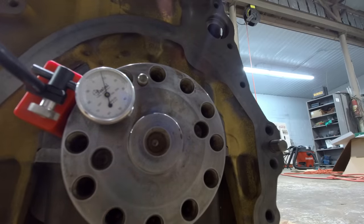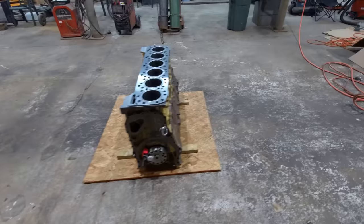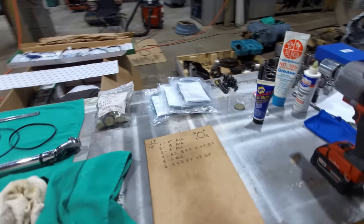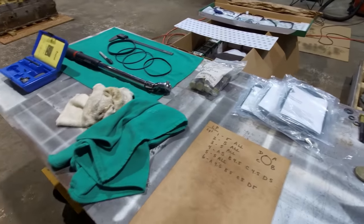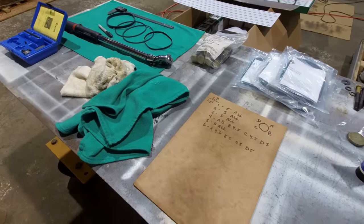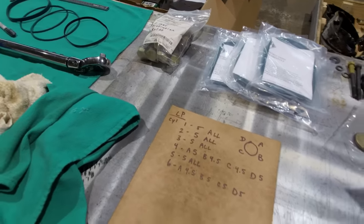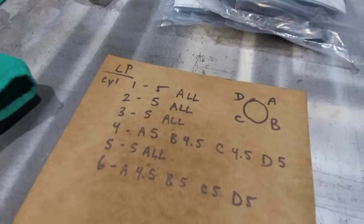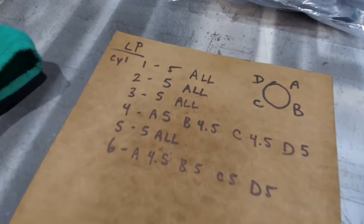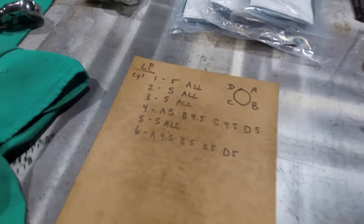Right back to 8 thousandths — that's well within spec. When I talk about something being in spec, I'm always talking about new spec, not max permissible. Like with crankshaft end play, I've got 8 thousandths on this engine. To be within new spec, I can have as much as 22 thousandths, and then max permissible with used bearings is 35 thousandths. Here's what I had for liner protrusion: it's pretty much 5 thousandths all the way across the board. Twenty-one out of twenty-four measurements are at 5 thousandths, and three measurements are at 4 and a half thousandths — so everything's within a half a thousandth. That's really good.